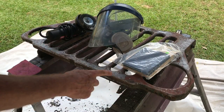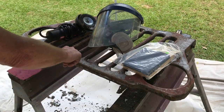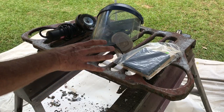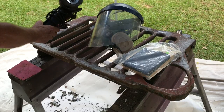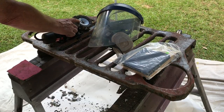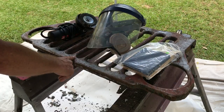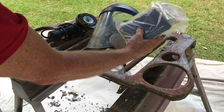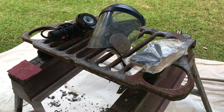So I've scraped the grille all up, took it out to the water hose, and washed it all off with soap and water. I've still got some little chunks of debris on here, but I've neutralized that stripper. What I'm going to do next is use some various tools and sandpaper to clean this off. I've got a pretty inexpensive wire wheel — when you're using that, you want to be really careful of those wire strands coming out at you, so I wear a full face mask and a respirator because there's probably lead in the old paint. I've got some old-school assorted sandpaper, some emery cloth, going right from 80 up to 320. I'll get into this a little bit by hand and clean this up as best we can.